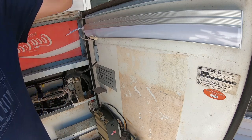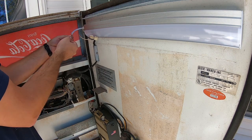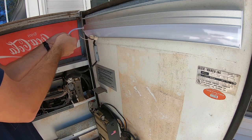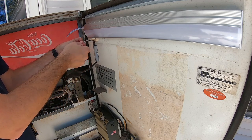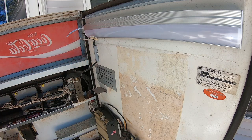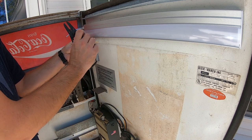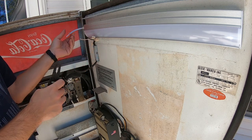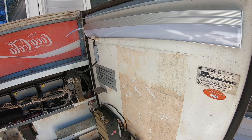All right, those wires are all stripped out. Let's grab our connectors and twist the wires to make sure they're nice and secure. We're going to use standard 12-gauge butt joint connectors — the yellow ones typically used for 120-volt wires. I just had these in my toolbox. Let's make sure all the wires are stripped and not too long, because you don't want them hanging out of the connectors. All we need to do is use those connectors to connect the two wires up.